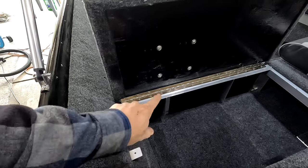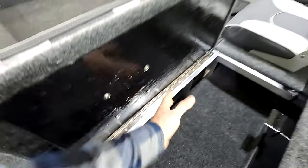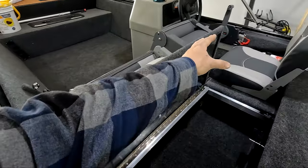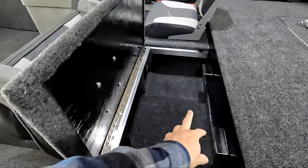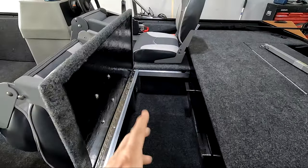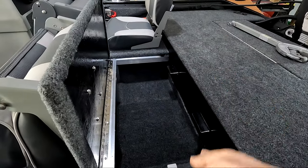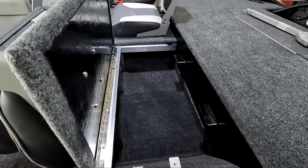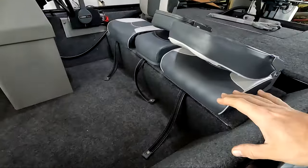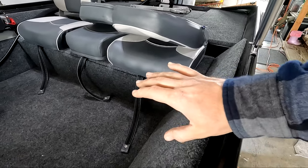For the hinging mechanism I'm using a 30-inch piano hinge - I'll have a link in the description if you want something similar. It came with screws to attach it to the wood, and I used slightly larger stainless sheet metal screws to attach it into the framing. The framing is all 1/16th aluminum with supports running down the front, and I added 1/8th-inch pieces along the back for a little more solid support. Under the platform I added a light hidden behind the back bar that illuminates the area perfectly.